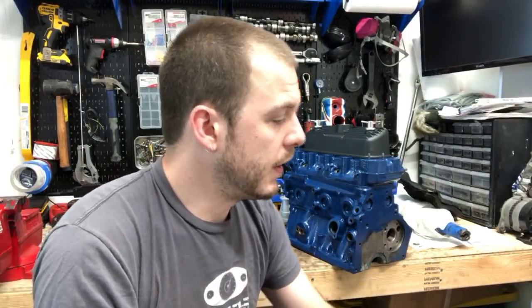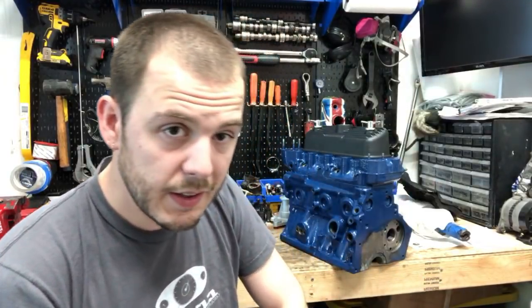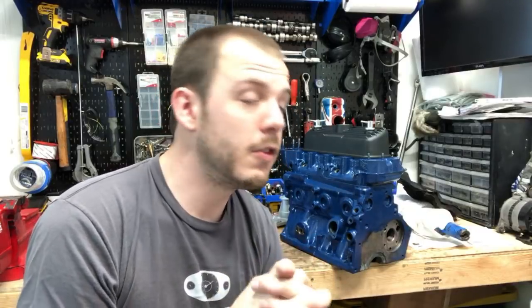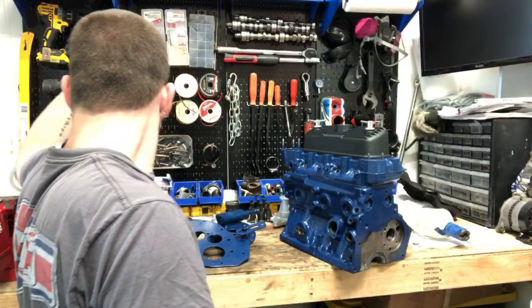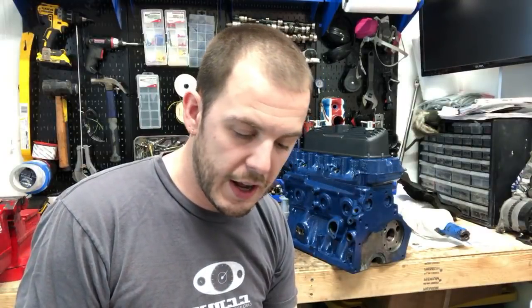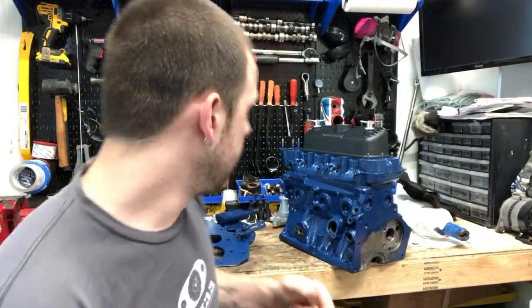So the sweet spot for that fueling, and I would recommend, if you have a rolling road or a dyno available to you, you can dyno tune it. That's the best case scenario. If you don't, the way you need to figure it out is by looking at your spark plugs. You've changed the fueling a little bit, feel how it drives, keep an eye on your temperature, and then pull your spark plugs out and take a look at them.